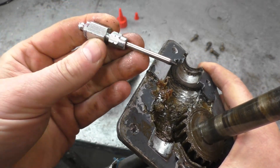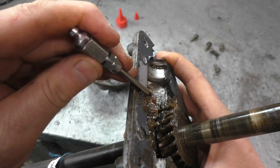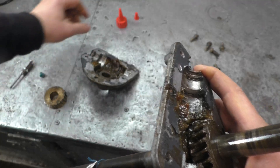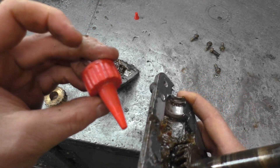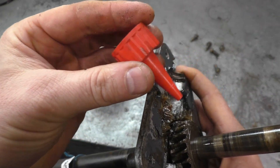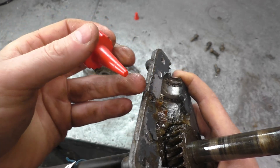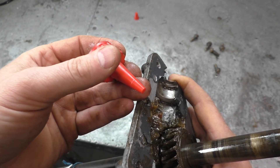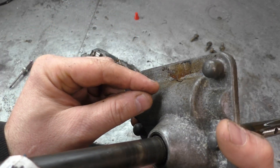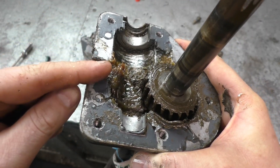It's very important that you use some kind of method to add grease. You can buy a needle injector that goes on your grease gun — just shove it in the small hole when it's all together and squirt grease in. You can also take the nozzle off a gear oil container and squirt grease in that way, or use a big syringe. Then just put the little cover back on. You could also drill and tap a hole to install a grease fitting.